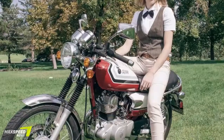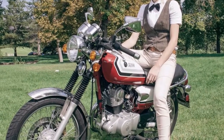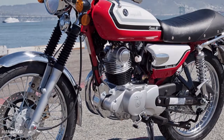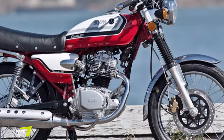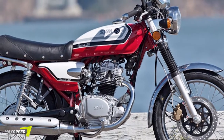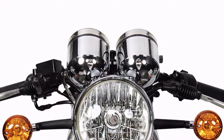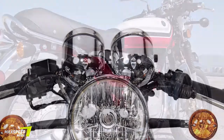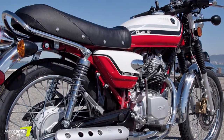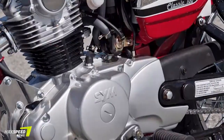The plant generates 9.04 pound-feet of torque at 9,000 RPM, backed up by 14.79 horsepower at 8,500 RPM. Not exactly earth-shattering, but again I point out the 266-pound net weight. These numbers give the Wolf a top speed of around 65.5 miles per hour, though I'm sure that changes a bit when you factor in rider and passenger weight, altitude, and headwinds and tailwinds.